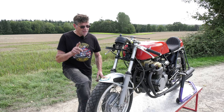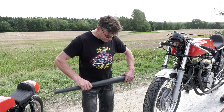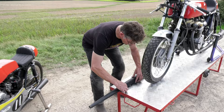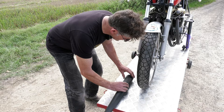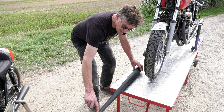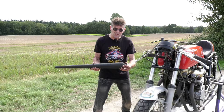So what you would do: get your 16 gauge steel and roll it round. If you've got a set of rollers you can start off with something round, then you're obviously going to get your taper. So you draw it, get the steel underneath, get it round, get it tight, tack weld it say four or five places. Then you've got that nice and tight and then you can cut off the waste. You can also put your grinder right down the middle of it — don't take those tack welds out. You just clean the whole thing up, then make your little tiny reverse cone on the end, which is quite easy to do.